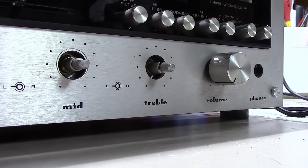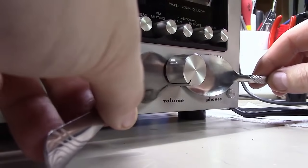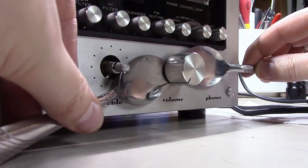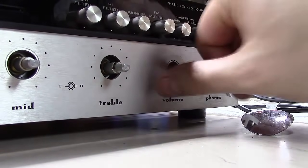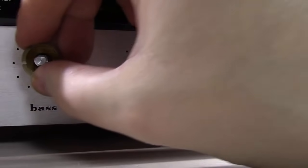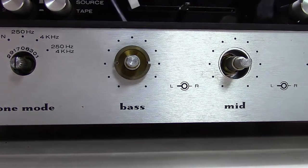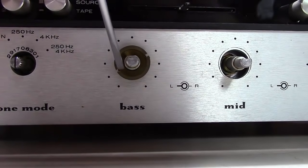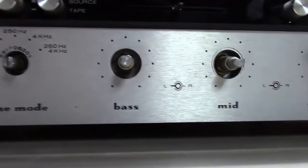I think I'm the first person to ever remove the face plate on this amp — it looks all original. One thing I've had to do to get these knobs off is the old spoon trick: two spoons, get them right in behind on both sides of a knob, and pry evenly all the way up against the shaft with the tips. The knob will come off and you will not have scratched your face plate. This little knob here that screws in was tight and couldn't move — I ended up taking a small screwdriver in the notch and tapping it lightly with a small hammer to get it moving, then it came right off.